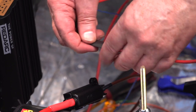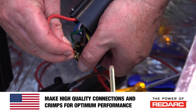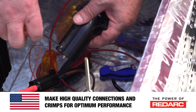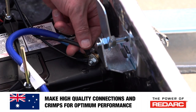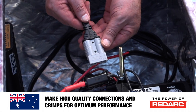The BCDC will continue to draw down on the tow vehicle's 12 volt power. The last wire to be connected is the BCDC input red wire. This wire is 6 feet or 1.8 metres long, which should be enough to reach the 12 volt auxiliary power available on the trailer plug, or it can be connected to a suitable point inside the toolbox if one is available.